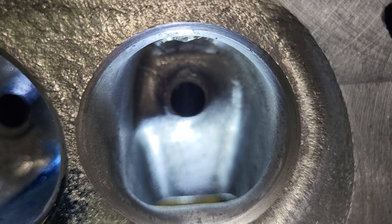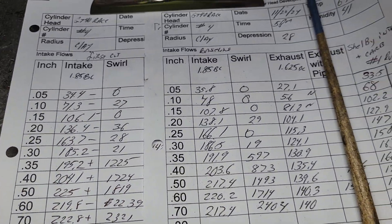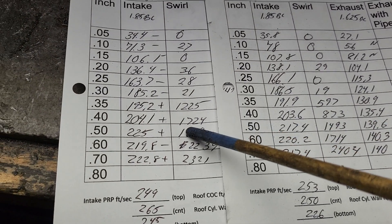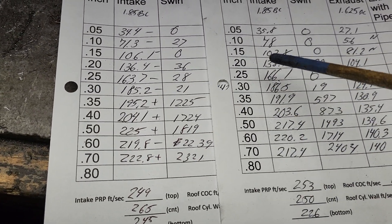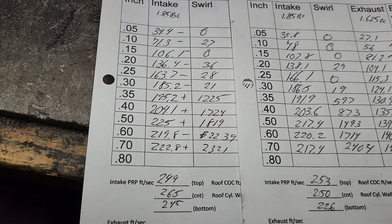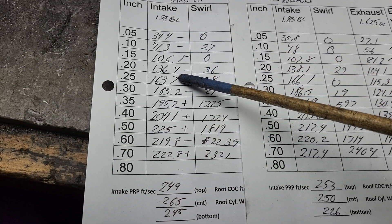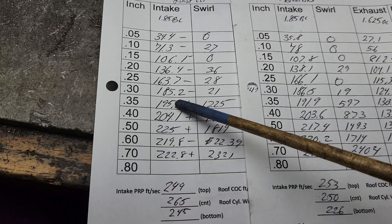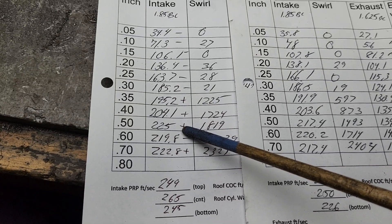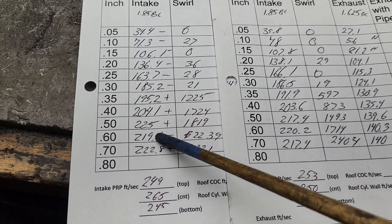Let's take a look at our flows and our speeds. First cut — baseline wasn't too bad, but it only topped out about as good as a well-ported E7, with a smaller valve no less. How'd we do? Not great. We took a hit everywhere. Remember, I put a rough texture on it — the rough texture does cost you some CFM, but it helps us with our fuel spray. We got a little gain right here, not terrible right here. 225 is still way less than where I think we should be, and then the short side has problems and it goes back down — actually less than what we were doing in that spot.